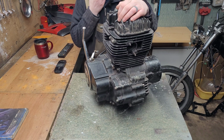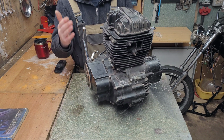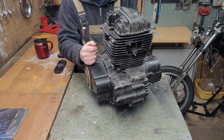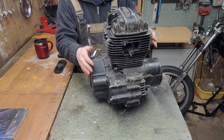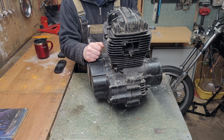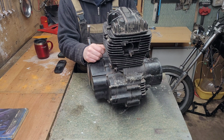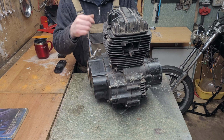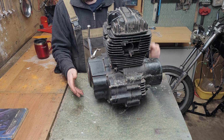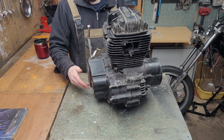The bike that I've got, what's the problems I've had with it? I had a corroded stator wire, which was an easy enough fix. The side stand switch went, which is a common fault in a lot of bikes, even your Japanese bikes. It's a problem they have, and it's because of the placement. The switches are low to the ground, they get covered in water, caked in mud, they fail. It's as simple as that.